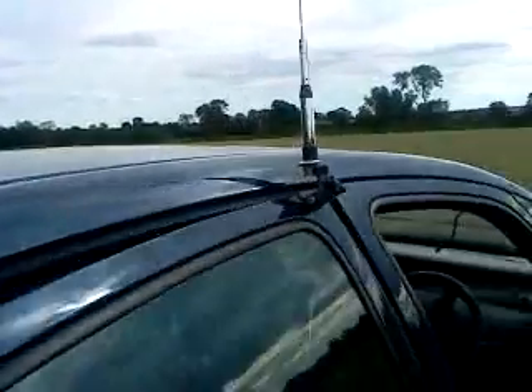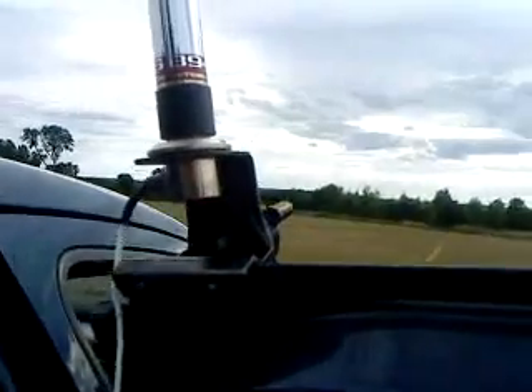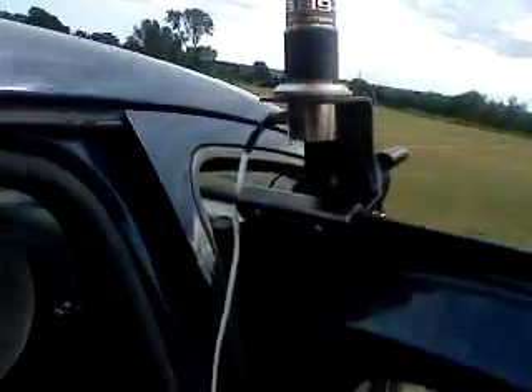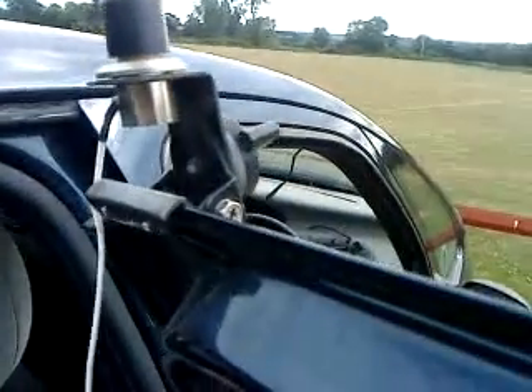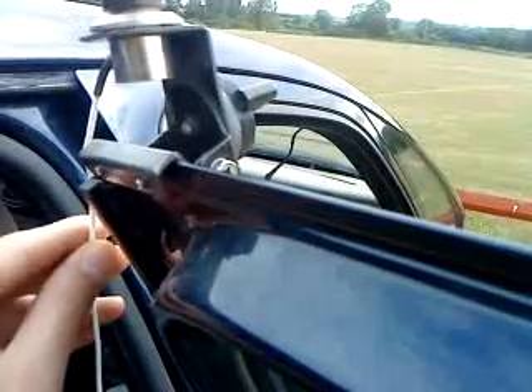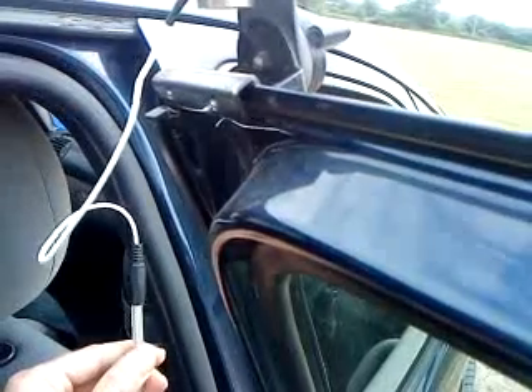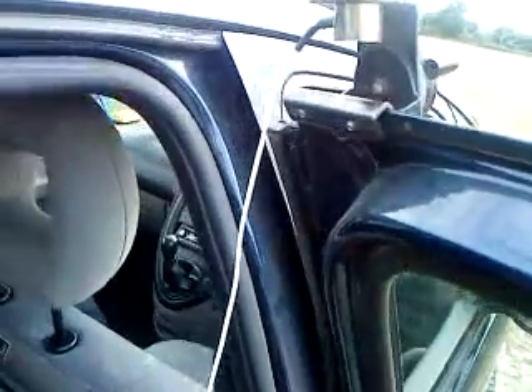It's not ideal because there's no gutters or anything on this particular Picasso. I've got a hatch mount which hopefully you can see okay. I've got one of these PTFE thin cable runs down to some RG174 that goes down to my Icom 706. This is just loose — it should really be mounted like that, but it works.